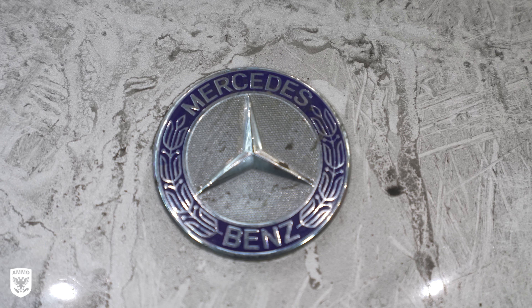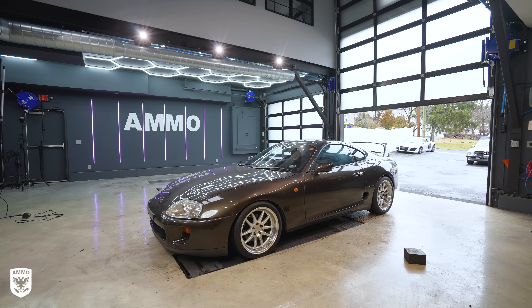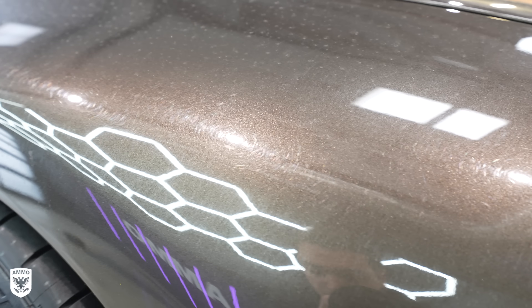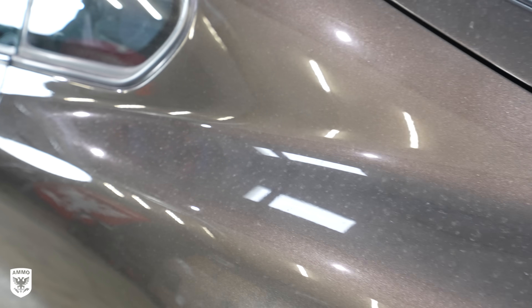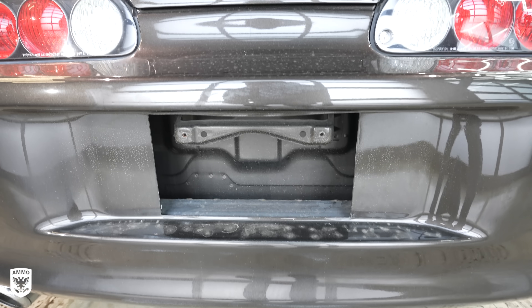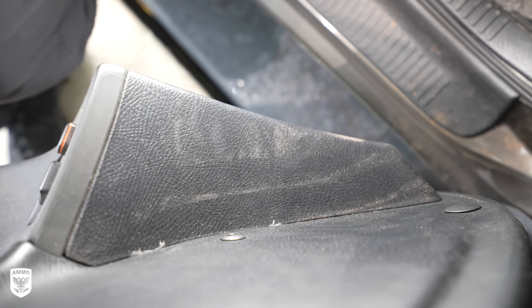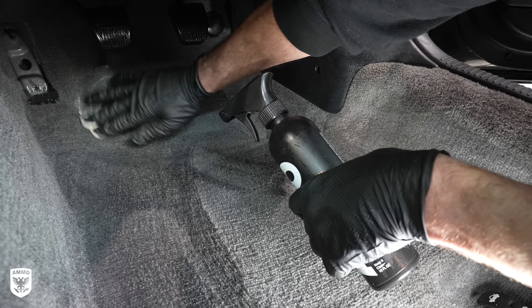The next day, when I finished with the Mercedes, it ran great, sold for a profit, and everybody was happy. So I pulled the Supra inside bay number one under the lights. The paint is in need of restoration, especially the driver's side front quarter panel. The headlights are beginning to yellow, there are water spots under dust and dirt, the interior plastics are blotchy from sun exposure, and the carpets have what looks like oil-based stains — not just the mats, but the carpet itself, so it's going to be more challenging to clean.